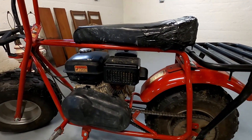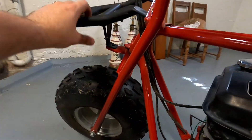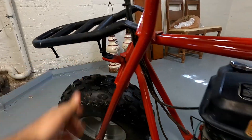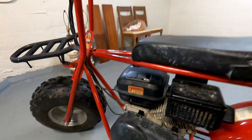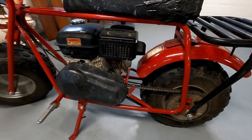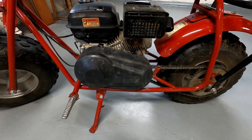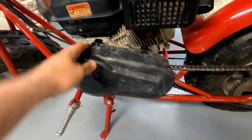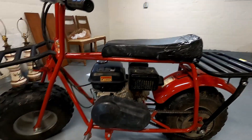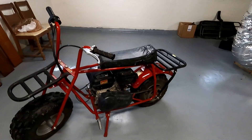It's a little old, it's missing some bolts on the fender and this front cage right here, but other than that it runs good — actually pretty fast. I'm not sure if anything's been done to it. I don't think the governor's been taken out, it doesn't have a CVT yet, I think it's all stock. It should run about 24 miles per hour stock, and we're about to do a speed test on it to see how fast it goes.